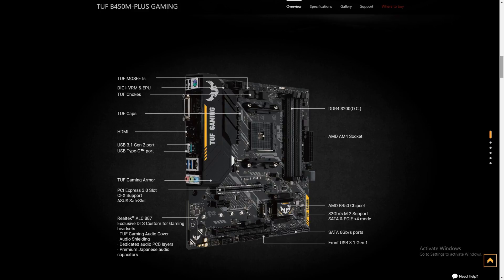What I think they should have done is swapped the location of the M.2 connector and the 1x slot, because with the M.2 you can slide it underneath your video card, and that way you can still use the 1x slot. The other slot you can use as your 1x for wireless or whatever, but for Crossfire it's on the edge of the board. Now, this is a micro ATX board, so you're going to have some compromises — if you want to use Crossfire, you're going to need a bigger case than a micro ATX case.